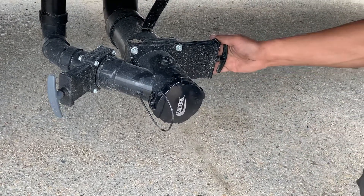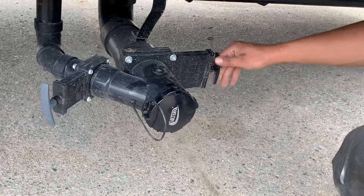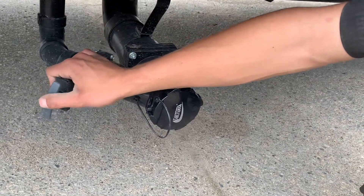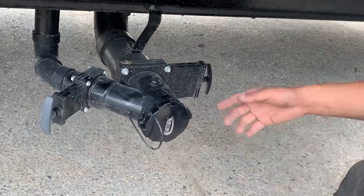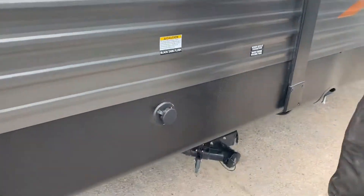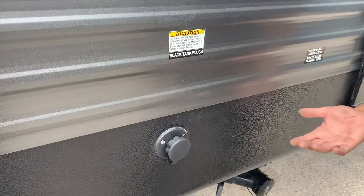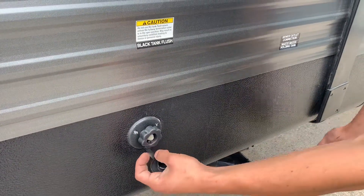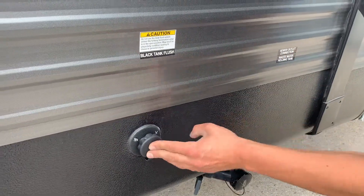On the right here, you've got the black valve signifying your black tank. When it comes to dumping out your tanks, you're going to want to do that black valve first — the black tank is filled from your toilets, which is of course the dirtiest water. Beside that we've got the gray, which is filled from your sinks as well as your shower, so generally cleaner water. Once the black is done, then you'll open up the gray as you're dumping it all out. Over time you may go to dump your black tank and it's just not going to read properly at the monitor panel. What you'll do is take your water hose, plug it in, open up that black valve, turn on this black tank flush and that'll clean out that tank and give you a better, more accurate reading.